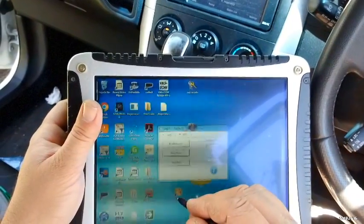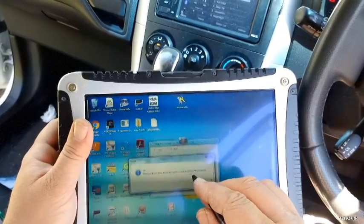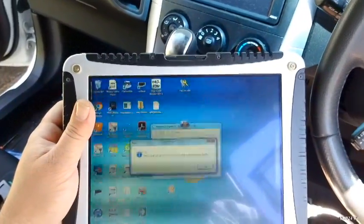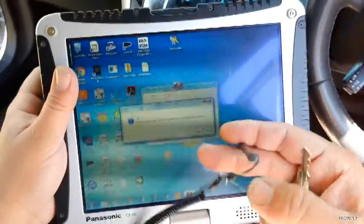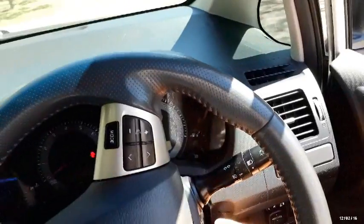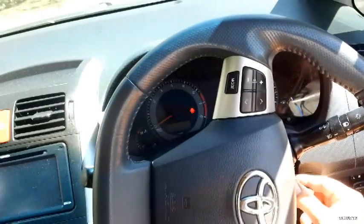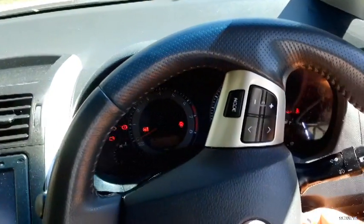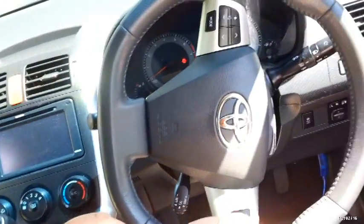Okay. Reset EMO. Okay, please pull out the key from the ignition lock to finalize reset. Okay, so our light should now be blinking. So we're going to put that one in first. Okay, turn on. Is our security light blinking? Okay, now we're going to go with our second one. This will be the next master key.